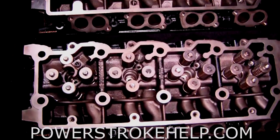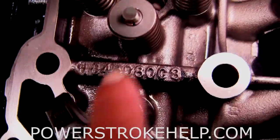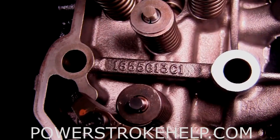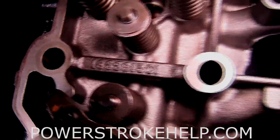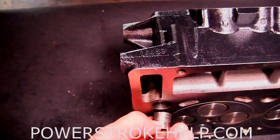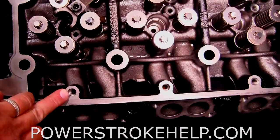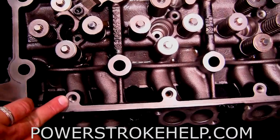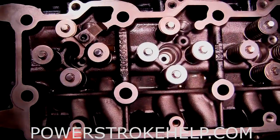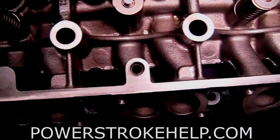We've got two cylinder heads here. One is the pre-commonized and this is what they call commonized. First of all, your casting number is right here. This is an 18 millimeter C3 head. This one, a 613C1, is a 20 millimeter head — it's designated by the size of the hole on the dowel pin. So you can see the step-down; we're on the large side of the step-down, meaning this is a 20 millimeter head. On the pre-commonized head, what we're looking for is the size of the holes that line up the rocker carrier — the part that sits on top that actually holds the rockers. Notice that this one's small and has all the bolts drilled, while the later model one is much bigger and only has a couple of them drilled.